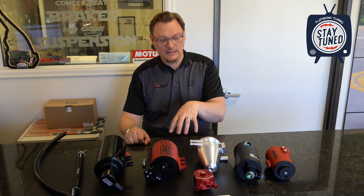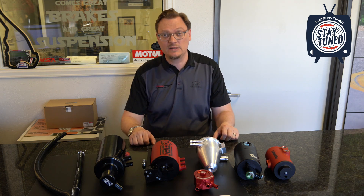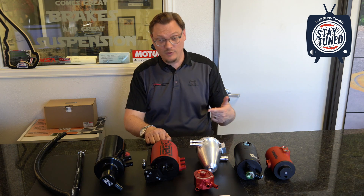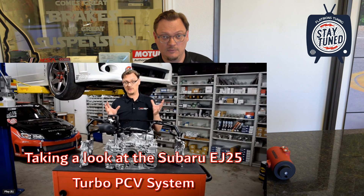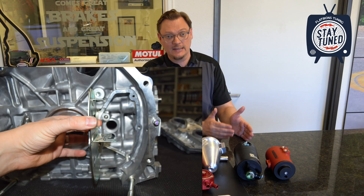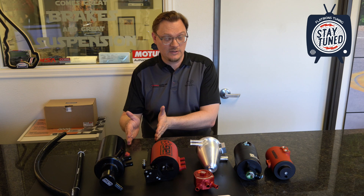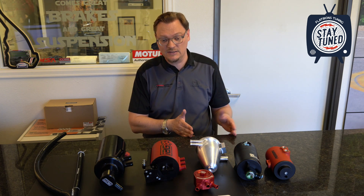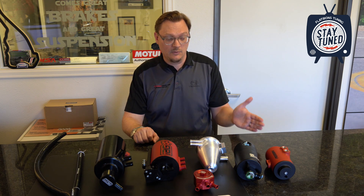The amount of oil that you're using is a key piece of information to help you pick which AOS is right, because that comes down to the size of the can — the capacity of the AOS you're adding. Worth mentioning: why didn't Subaru put an AOS on the car from the beginning? Well, it turns out they did. If you watch our video on how the PCV system works, we talk about where the factory AOS is on the back of the engine. Where it starts to falter is basically a case of how much power you're making, what you're doing with the car, how much time you're spending at wide open throttle. You run into a case where the factory AOS runs out of capacity and that's where you start to have issues moving oil through the PCV system — and that's where an aftermarket AOS or catch can can come into play.